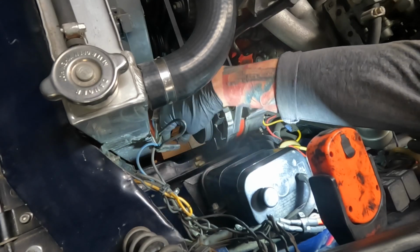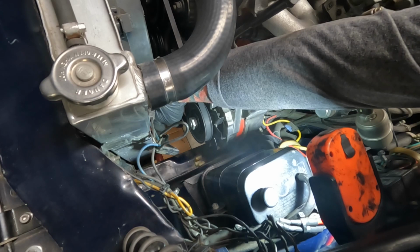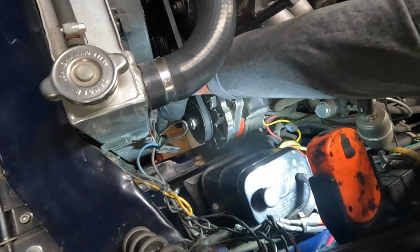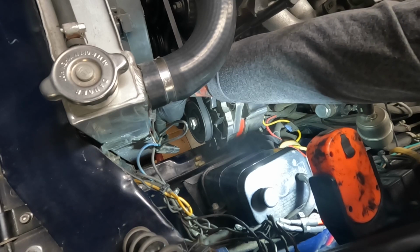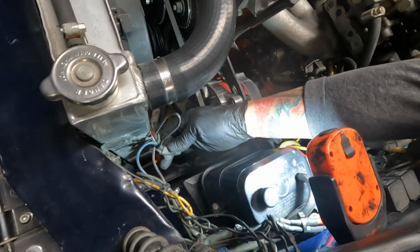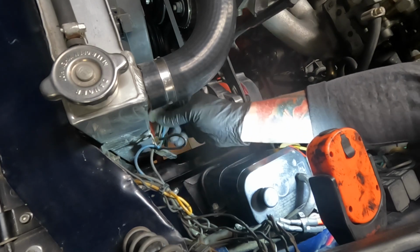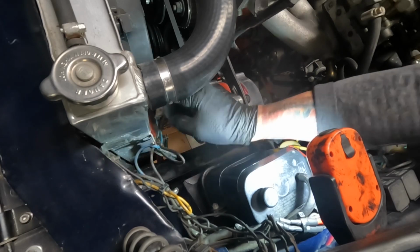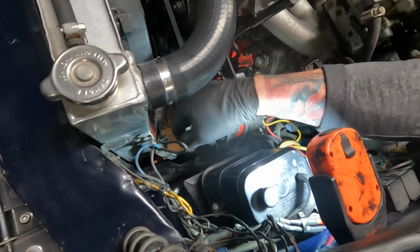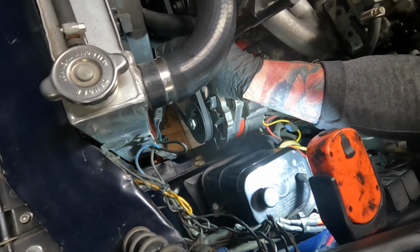And it plugs into your thermostat. Is it a thermostat? It's not a thermostat. Well, it's a thermocoupler, but you know what I mean. From the factory, it plugs into the sensor on the bottom of the radiator. The wires coming out of that are both black. They plug into this plug, which are both black, and then that plug's connected to your factory harness plug, which is blue and black. So if you're having trouble wiring up your radiator from the sender, it's all connected to the factory wiring. I didn't alter any of this. I just altered my fan. I hope that helps.